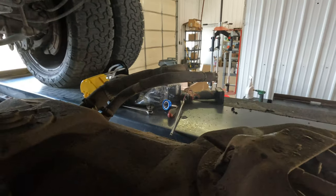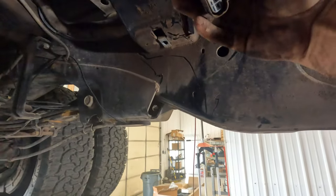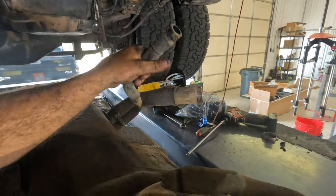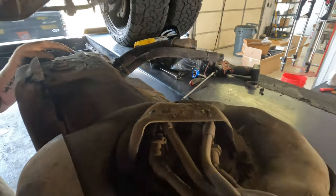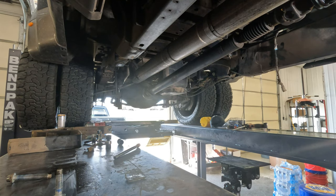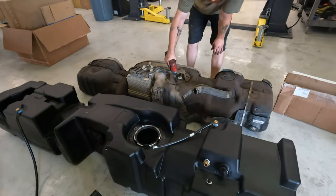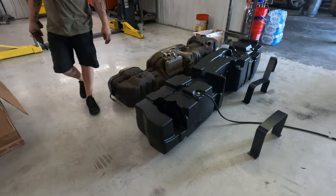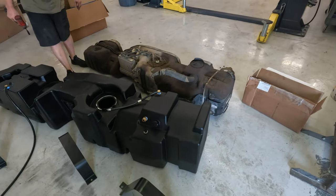We're going to get this all the way down to the ground. Here's the electrical plug - you have to reach up in there and unplug it, then that allows it to drop down. Disconnect your filler neck lines and go ahead and set it on the ground. It's not very heavy with just a few gallons of diesel in it. Here's the comparison - look at the size difference. It was actually a 68-gallon factory tank, and the new SNB tank gives us 24 more gallons.